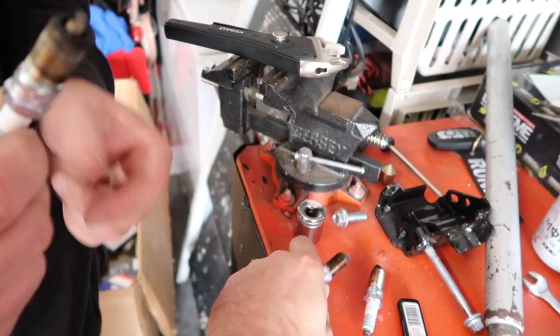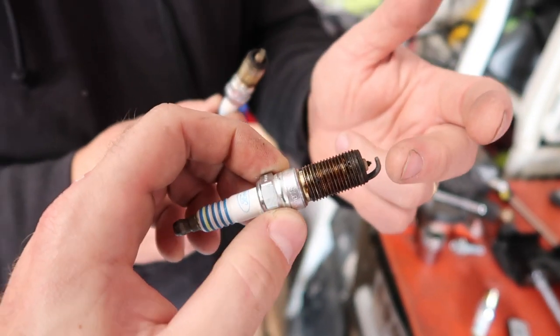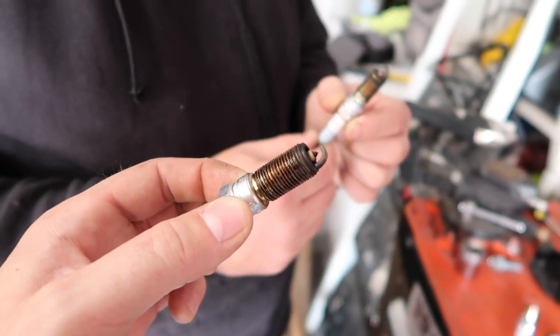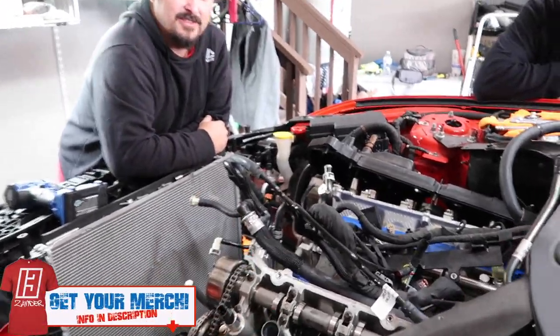Everything looks fine. Look, you think it's okay? So we got a little oil on two of the cylinders. I don't see buildup right here like when you're burning a lot of oil. Yeah, it looks fine. I wouldn't stress it too much at this point. If you do start suspecting something, do a compression test. Compression test, yeah. Good. I'll come see you and we'll figure it out. Probably blow by, but... I think it's the tick.